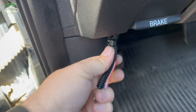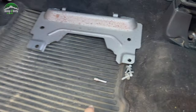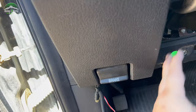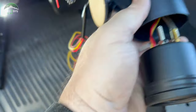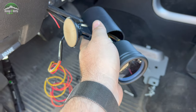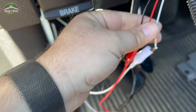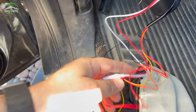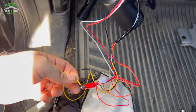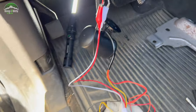So if you guys remember from last time we ran our cables down. Went ahead and took off the panel that goes right there — there's also this metal plate that goes right there, we took that off too. That uses seven millimeters, those are eight millimeter heads. Now we're going to try to pull the cables through, get our wiring up here and get this figured out. I got the line in, I got the wires in, it's all connected up. Now we just got to figure out the wiring situation. According to this gauge pod: black is ground, red is switch, white is the wire, yellow is constant, and orange is dimming. So we're going to have to find a dimming wire and connect it to that. But for right now I just want to make sure that it works.